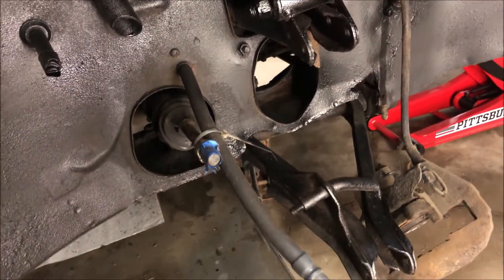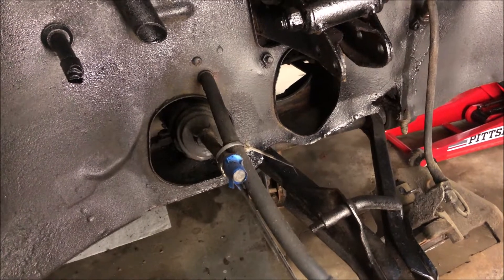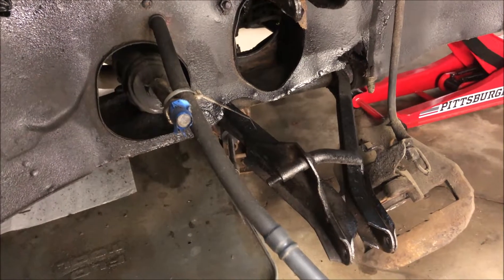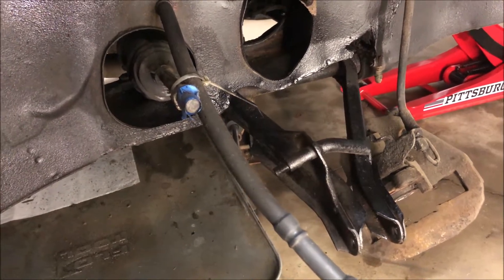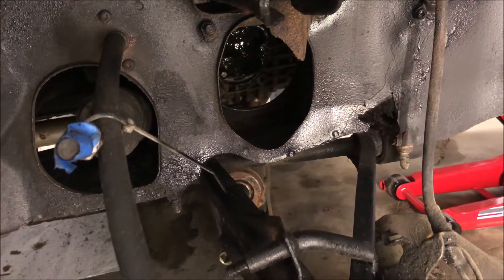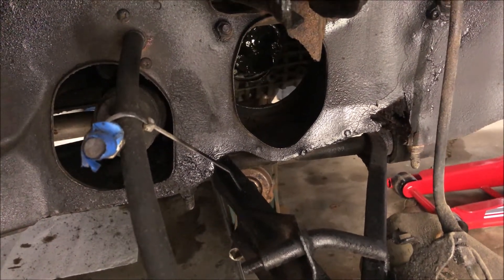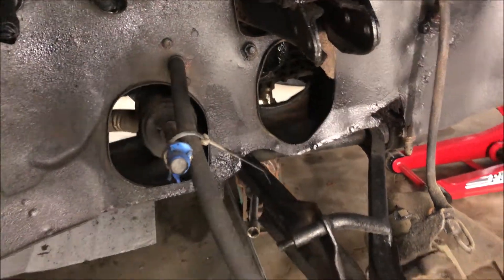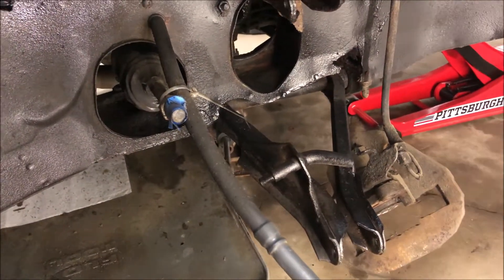I've got the hub on the other side there — I'll have a new bearing pressed in. I've got the engine lifted up right now so I'll have to get a mount that I don't have. I'm going to have to have the hub pressed because I don't have a press, and I'm still trying to source an inner driver to get that replaced. With the mileage on this car, I don't really want to put it back together and find out it's bad — I'd rather just do that now. So I need to do that and the caliper.